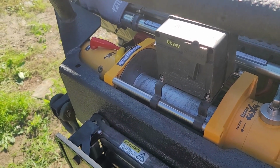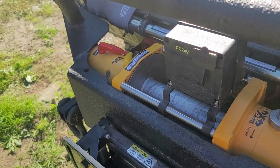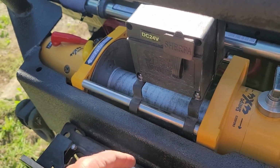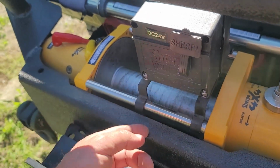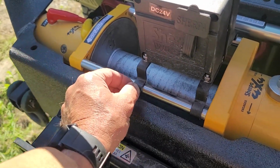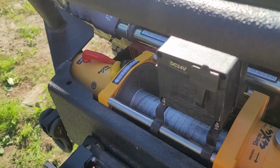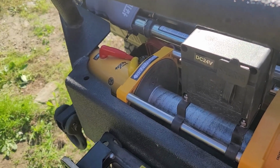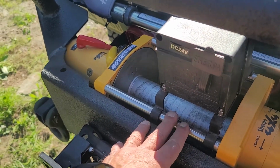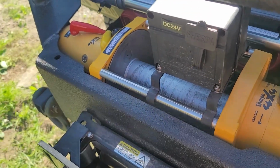I believe the reason is that the steel cable bunches up and doesn't provide enough clearance for the cross members right here. It's about 90 foot. When you're recovering, you can't roll it up really nice like this, back and forth in a very orderly fashion. It's just not realistic in those kinds of conditions. So inevitably you get some areas that are higher than others, and the area that was higher was right around here, and it just pushed up against it and broke off.